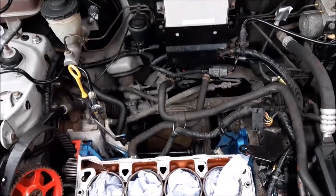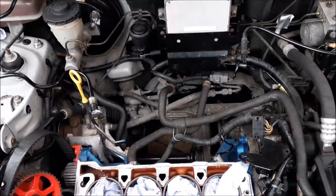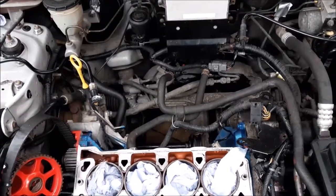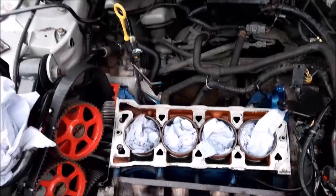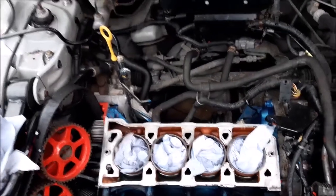The other 45 we took on was our other silver one, and that was losing a lot of water. It hadn't been overheating, but it was losing water and getting small airlocks, and that turned out to be the gasket on the inlet manifold had gone. And the final time we've had what's suspected as a head gasket, it was the water pump leaking, which again the water drained down, caused an airlock and gave all those problems.